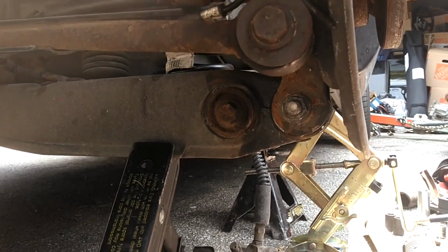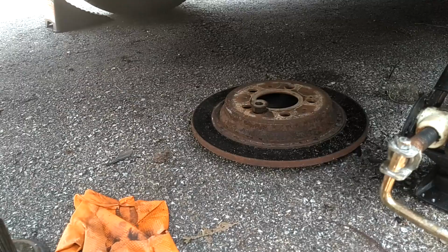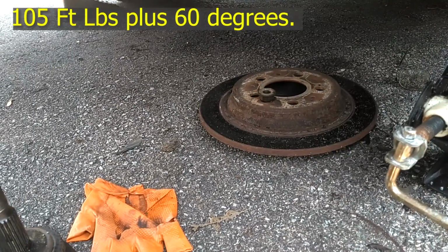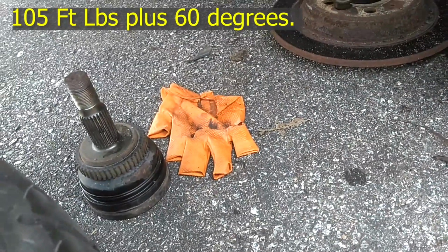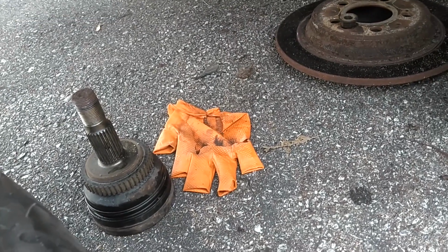Now I'm gonna lower this jack, put that CV axle hub in and torque that down. Probably 87 foot-pounds and 60 degrees, but I'm gonna check and put it in the description below.